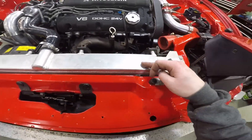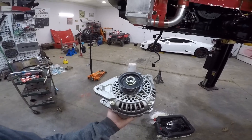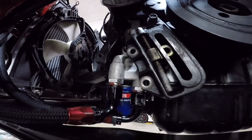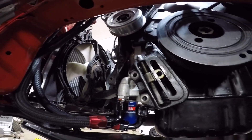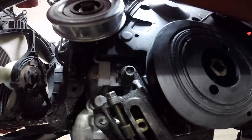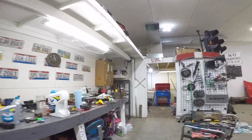I don't think I've ever taken it off while it was in the car. Is it because I got an upgraded radiator? If I had the factory radiator, would it slide out maybe? I ended up having to take the tensioner pulley off, then loosen those, take those two bolts out, then loosen that bolt so that can slide out the way — and then I barely got it to fit. It's gonna be a nightmare to get back in.